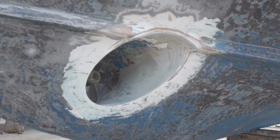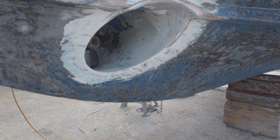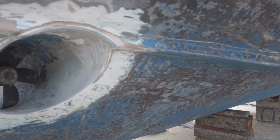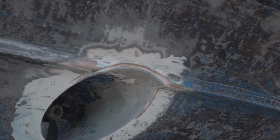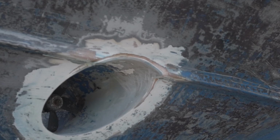So now we're on Monday, we lifted on Friday. Managed to get quite a bit of the whole top side done, but more importantly what I wanted to do was open up the areas that needed a little bit of repair. And now we're nice and dry, so I've just given it another fine light sand with a Dremel, and I'll acetone all of that, and I'll mix up some thickened epoxy, so we'll start epoxying, rebuilding this up.